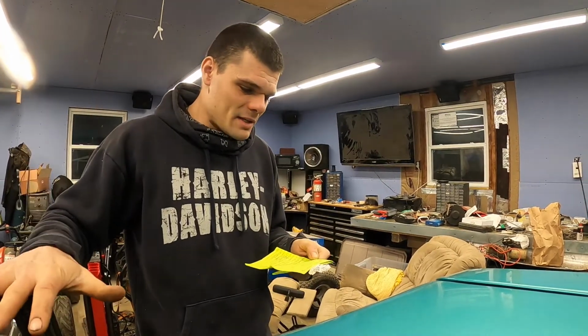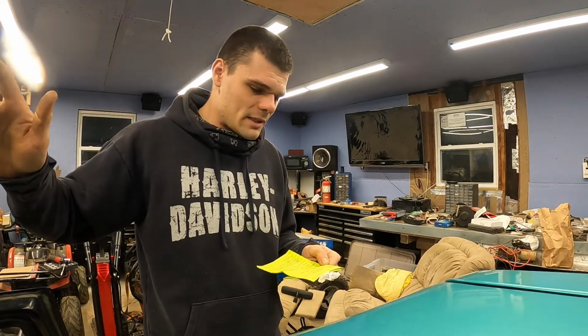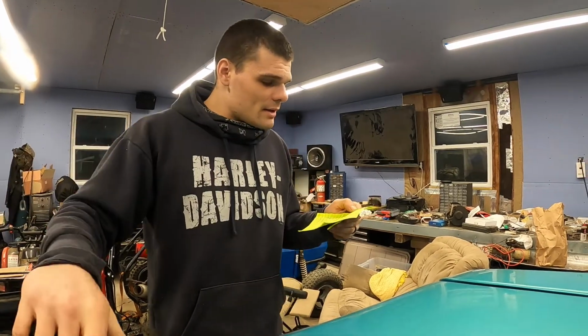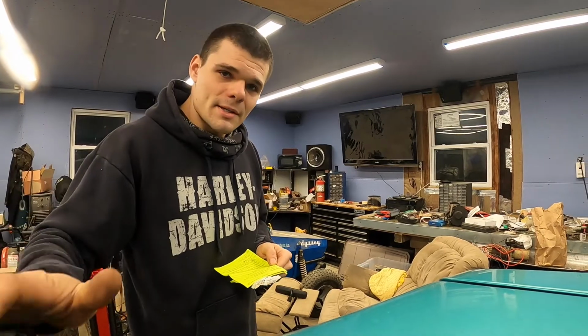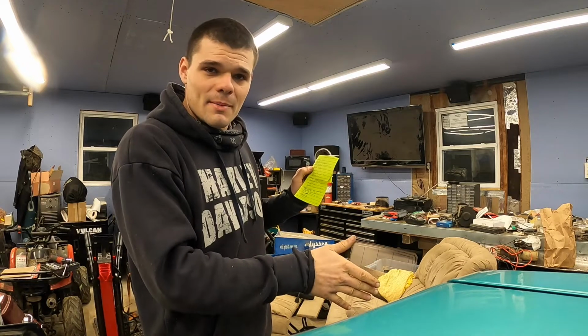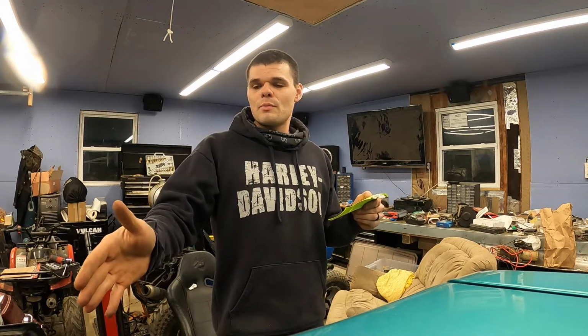Looking at getting the correct battery. I need to get a clamp for the radiator after I get the correct battery on it. Front tires at the very least, possibly rear as well, we'll see. I'm looking at doing a rear disc conversion on this. One of the brake lines burst in the back, so that's something I'm looking at doing. And with a disc conversion, I can also rewire the parking brake in this car. That was all apparently cut out at one point. I want it back, that way I can have a parking brake versus just putting it in gear.